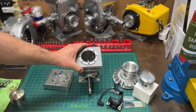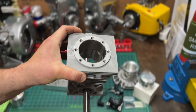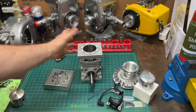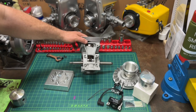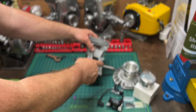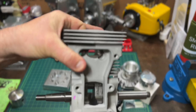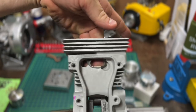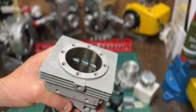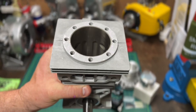In the back of the cylinder you can see a boost port — that's one of the main differences between one of my racing engines versus this stock utility engine. The boost ports are a big difference, as are the modified ports. I based all of this off of Dick Till and Ackerman — he talked about port shaping, round versus square, and where that helps the RPM range. This configuration has siamese transfer ports left round, squared exhaust ports, and added boost ports in the back of the cylinder.